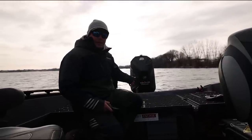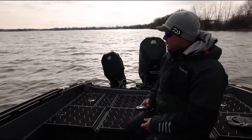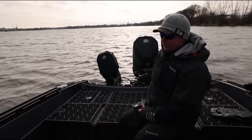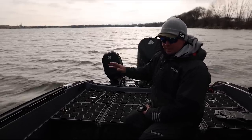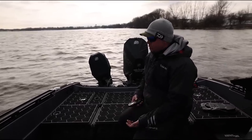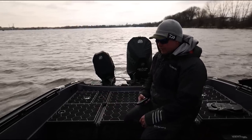That's hooked up to the 10-inch T&H jack plate in the back. My kicker is on my starboard side, which a lot of people ask me about because basically all boats you see have the kicker rigged on the port side. The reason I like it on starboard is it gives me all the room in the world in my corner for figure-eight fish, landing fish — I want that kicker on the other side, out of my way. This is a 15-horse Pro Kicker from Mercury. It's got all the power I need for trolling into three- to four-foot waves, and I can do speed trolling at five or six miles an hour. We've got that on the tie rod, and controls are up front.